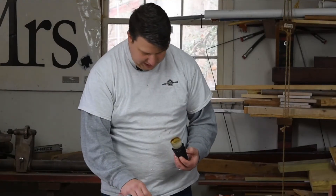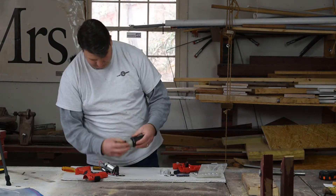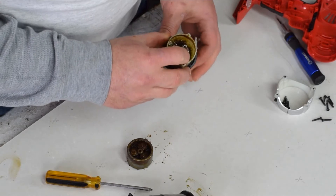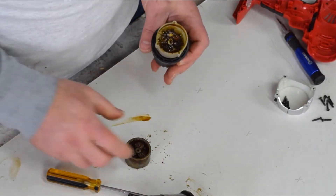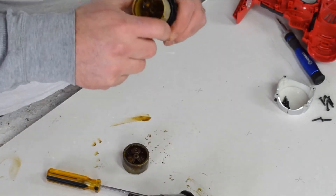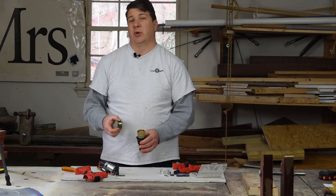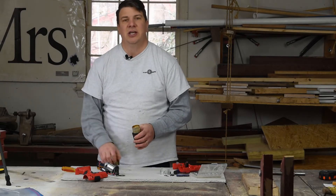It looks like the output is connected to the planets. The drill shaft is attached to the carrier of the planetary gears. The ring has little nubs on the back that interact with a ball bearing, so I'm guessing there's a spring pushed up against the ring gear. If the torque gets too much, the little tabs would slip and make that clicking sound — you know, when you over-torque something.